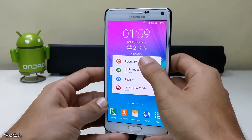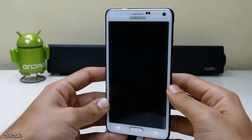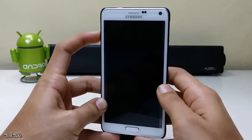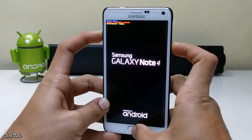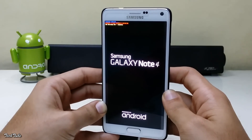Turn off your device and download the ROM, the latest Marshmallow Google Apps, and the FixZip from the links in the description box below, then save them into your SD card. Start by pressing the volume up, home, and power button altogether. Wait for the Samsung Galaxy Note 4 logo to pop up and then let it boot into recovery.